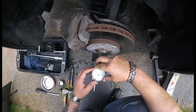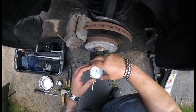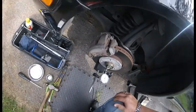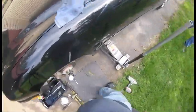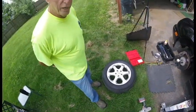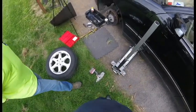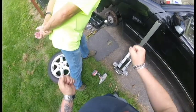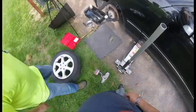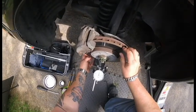I'm readjusting the wheel bearings. You've got to grease them and pack them. They're packed all right — I'm going to throw some more grease in the cap. You're actually better off a little on the looser side than too tight. Yeah, too tight you burn them off. I just tighten them with a pair of channel locks and back them off just a little so I can get the spacer with the cotter pin through the slots. If you tighten them too much, you don't leave any room for the grease — the metal's not supposed to actually have contact, it needs a cushion of grease in there. This is 0.393 to 0.787 thousandths. My brother Richie had one of them recently. I'm giving it just about a thousandth of an inch.